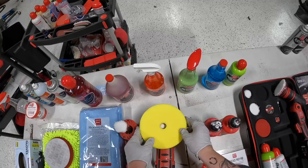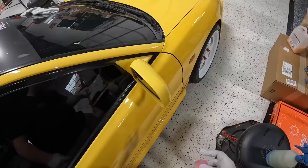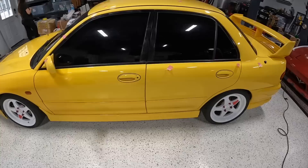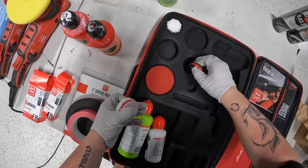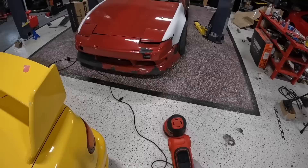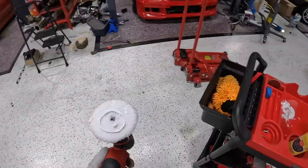After you finish claying is when you start polishing. After everything's done I'll go over it with just a perfecting cream, but I'm going to go ahead and start using the hybrid micro polisher. Griot's actually has a super no-residue tape that I'm using to mark off sections — sometimes I'll even use product on the paint since I know I'm going to use it anyway. This helps keep track of what's going on. Got the one-inch set up right there — that's sick — and the two-inch right here.